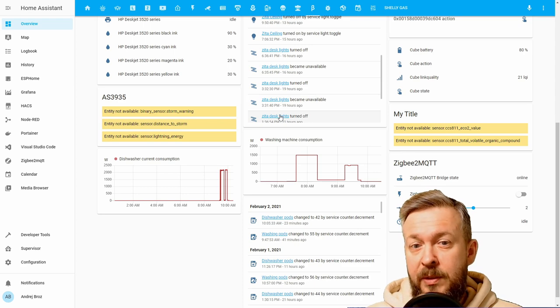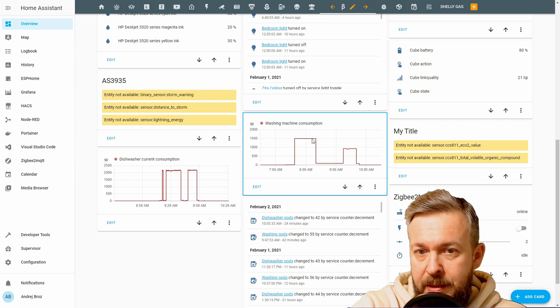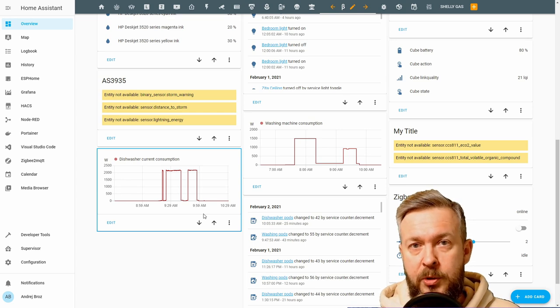Let's look at the differences between the dishwasher and the washing machine in terms of power usage. The dishwasher pulls much more power, peaking above 2000 watts, while the washing machine goes to around 1500 watts. There are small consumptions at the beginning and a smaller consumption during the washing cycle. My dishwasher drops in the middle of the cycle to somewhere around 3 to 5 watts. So I have to find the lowest point in power usage — in this case, 3 watts.